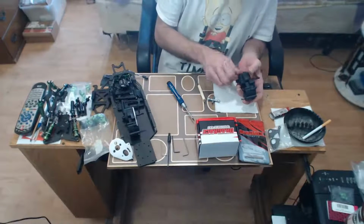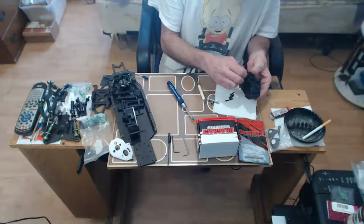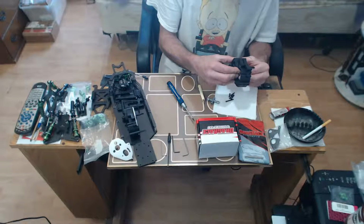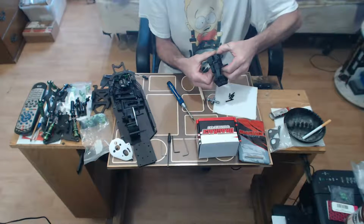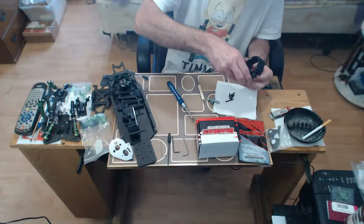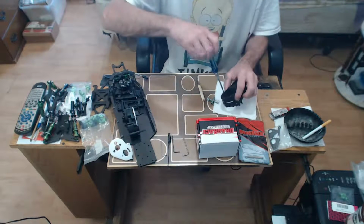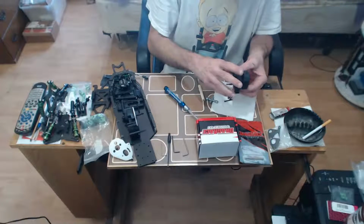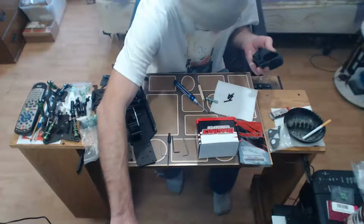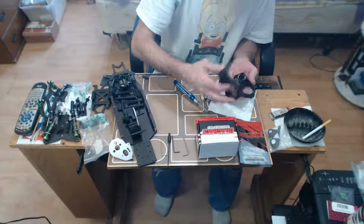So yeah, after doing a bunch more reading, I was always a little concerned about these RPM trannies because let's face it, this RPM plastic is more forgiving, but that means it also flexes a little more. And when it flexes more, it's going to wear out. And bearings get hot. They heat up that plastic. That plastic gets softer as it's warmer. And of course that leads to all sorts of issues with the bearings slipping and causing problems with alignment and everything else.